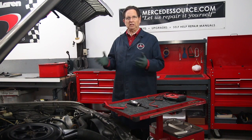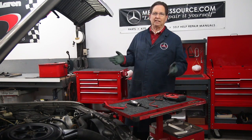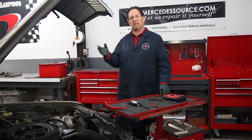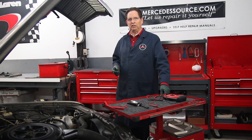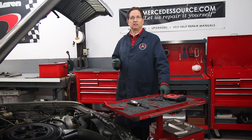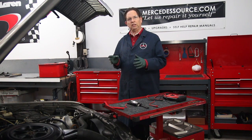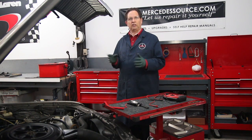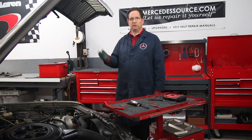These are powered with a relay. Anytime your diesel won't start — we get emails like this all the time — this is particularly important as winter approaches. This is part of my pre-winter inspection to get my diesel ready for winter driving, because bad or weak glow plugs can literally leave you stranded when the weather gets cold. So if your engine is showing signs of hard starting or not starting at all, one of the first things you want to do is this quick systems test.